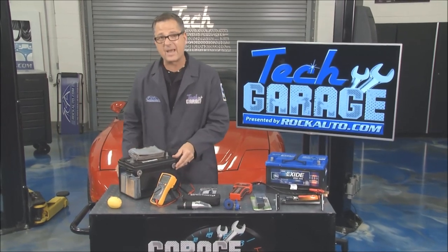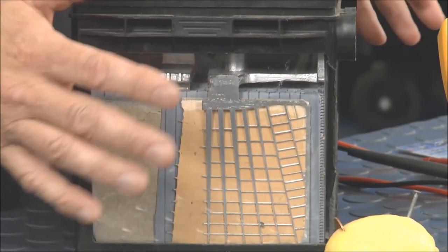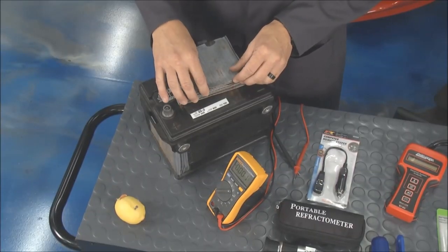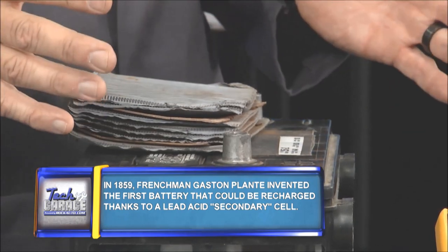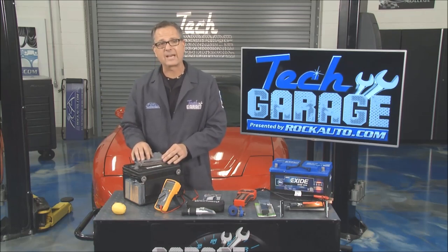You can actually see inside of this battery right here. If you look down here you can see there's plates, there's grids, all kinds of things going on. They're just positive plates and negative plates sandwiched together, insulated with this envelope so they can't touch. Through different sponge leads and chemicals going inside, it makes pressure — voltage. You put a bit of electrolyte, a little bit of water, sulfuric acid, and you get what's called electrolyte inside your battery, and it makes that chemical reaction.